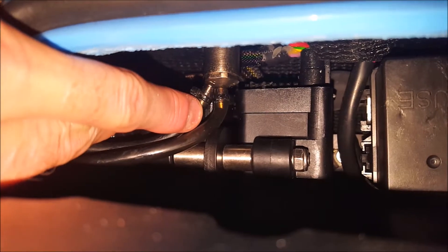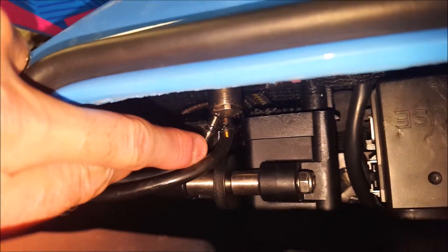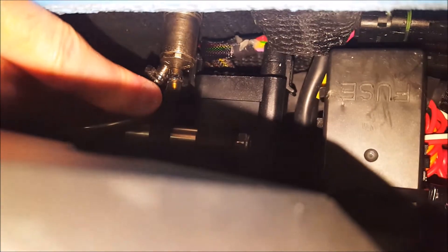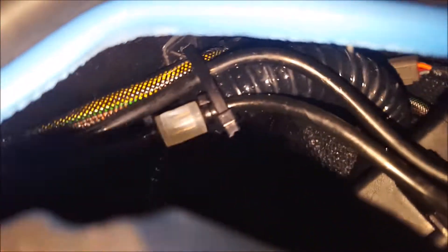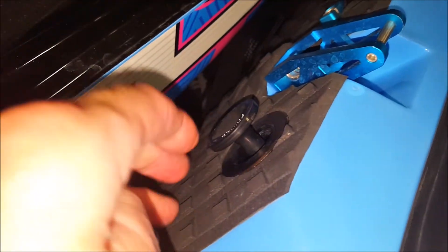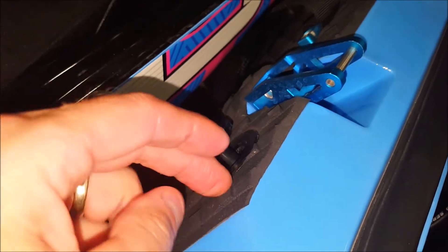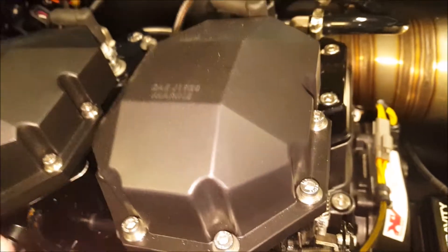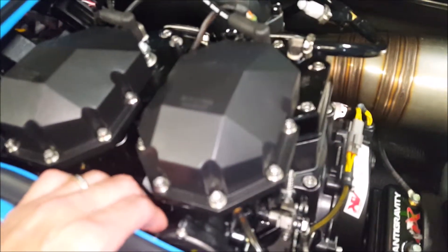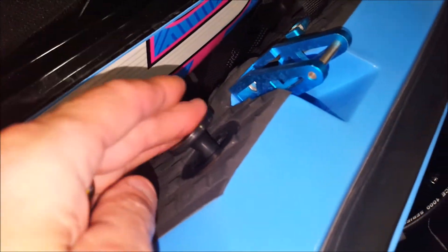Back in here we have the primer system. Your inlet line is going to come into this angled fitting here if you have a plunger-type primer or a push-button type primer. It's going to come back out of this straight fitting and go to the pressure relief valve set at 6 PSI, and then it feeds over into a T and goes into both carburetors. I recommend this plunger type way more than the bulb type. The bulb type moves about a half inch of fuel per push, whereas this moves about six inches of fuel up the line, so you can prime the carburetors and get the ski started way better with a plunger-type primer. We sell just the plungers on the website — you don't need all the lines and fittings because you've already got them on your carbs.